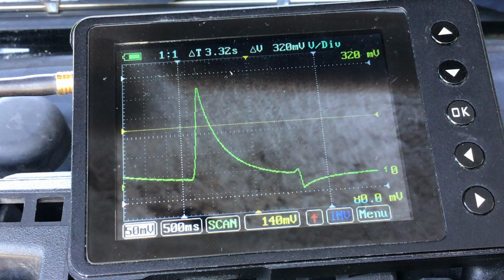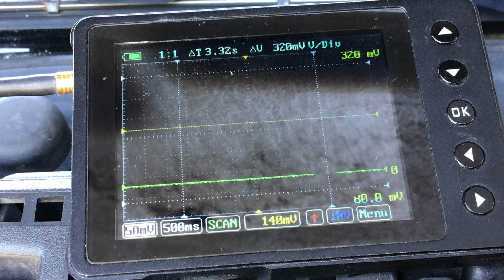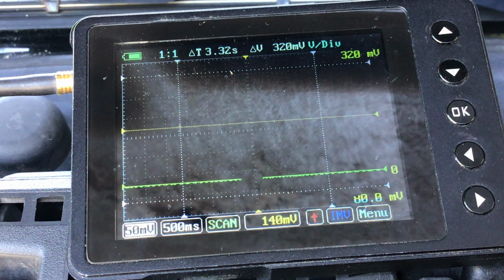Okay, I know I'm probably there because I started to go down. You see that? I'm going to look at the balancer. It's at least good enough for the leak down test. If I was splitting hairs with a timing chain, I'd probably have to get it more exact. But nonetheless, on a good cylinder, both valves should be closed. It is at the top of the compression stroke. I'll look at the harmonic balancer, and my notches on the harmonic balancer are really close to the notch on the timing cover on this Honda.